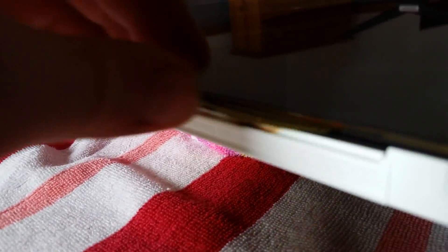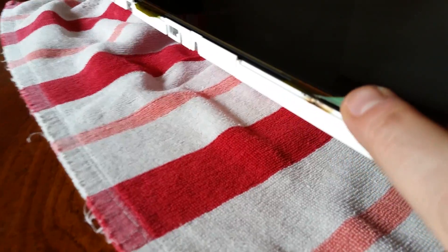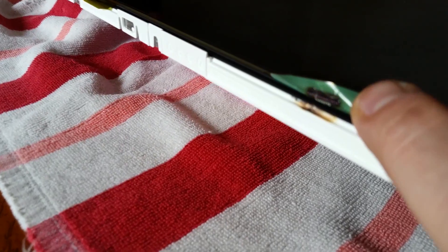Here is the reason for the vertical lines in this panel. I'm going to see if I can get a focus on that with some good light. As you can see, the tab bonding — I had to pull the frame apart to get to this — but there's the problem. She blew. The panel is bad.